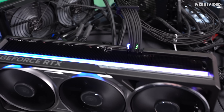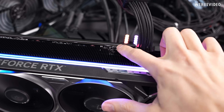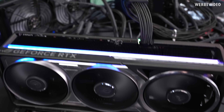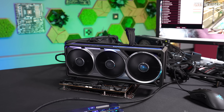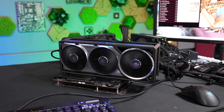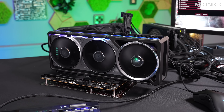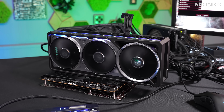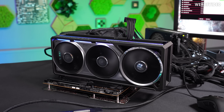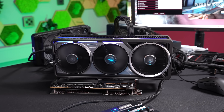I switched it to Q-Mode — the BIOS switch you can see here. Stock condition was P-Mode, but this is also an older sample. So P-Mode is on the left, Q-Mode on the right. I raised my opinion to ASUS that the stock condition should always be Q-Mode. That's similar to what MSI is doing, and they're doing it correctly in my opinion — the card is always shipped in silent mode. You're losing like 1–2% of performance but it's so much more quiet, which I think gives the average user a better experience than running P-Mode.